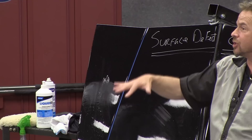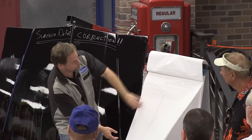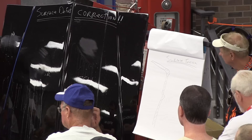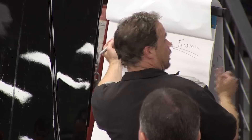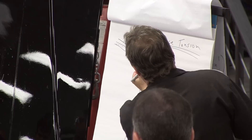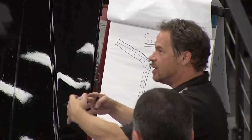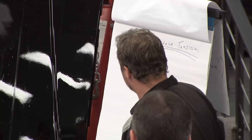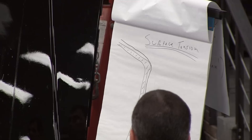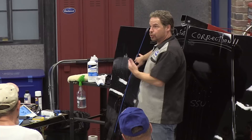Surface tension is what keeps a mosquito on the water without sinking — and surface tension applies to our paint jobs. Paint kind of stretches around a corner — here's your substrate. We've got a clear coat layer, and when it gets to a corner, it kind of stretches out. You've still got mil thickness there because it's still shiny, but it gets stretched around that corner. With peaked edges, it gets stretched thinner because of that surface tension pulling the other edges down — like a balloon stretched over top. When doing a rub-out, it's thinner on that corner and more susceptible to the pad grabbing it off. That fine line tape technique is the best I know to protect my edges.